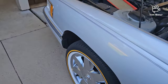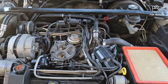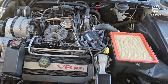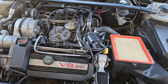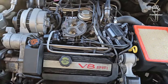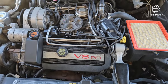And guess what — we're right there at 13.4. That's where we need to be at. So now I can go ahead and put everything back on here. Since we know the idle speed control motor is working and we got the right reading, now I can button it all up. You have to let this thing idle for like 13 minutes — that's the procedure for this. You let it idle down for 13 minutes, shut it off, leave it off about 20 seconds, then turn the key on.